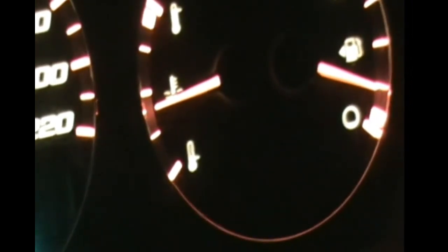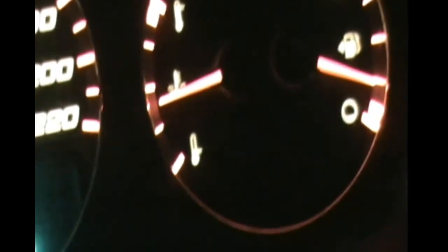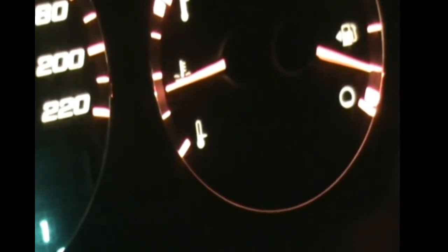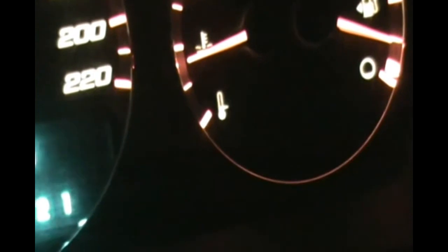And once it reaches half, and keep it there and the heater is on and everything working fine, go back, check the water level, and if the water level needs to be topped up, just add it. Don't add it in the reservoir, add it from the place where I showed you. Add it right here. So that's where you add it.